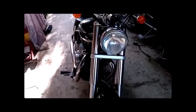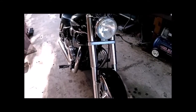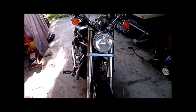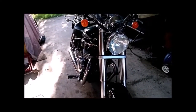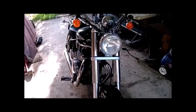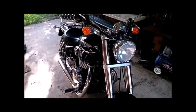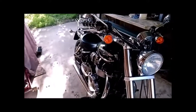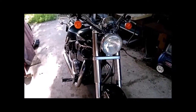In the reassembly, I think I'll be leaving these top and bottom covers off for now. I'm changing to a 15 weight oil, and just want to give it a run and see how it goes. In the winter, in about 3 months time, this bike will be getting fully rebuilt, stripped down to the frame and reassembled. So at that point, if I'm happy with the 15 weight oil and I want to put the covers back on, I will. The headstock will be coming out, new bearings, new wheel bearings, swing arm bushes and so on. But for now we're just going to try the 15 weight oil and see how it goes.